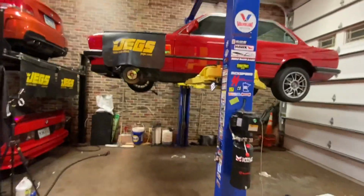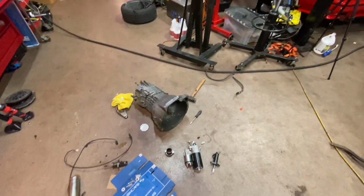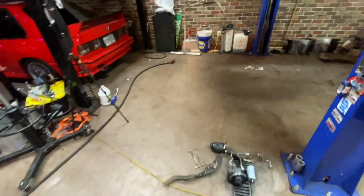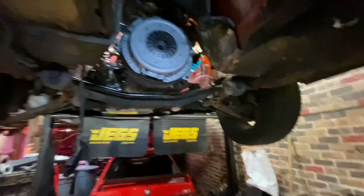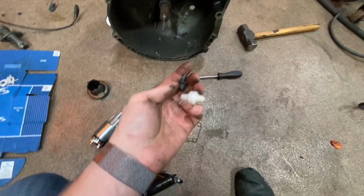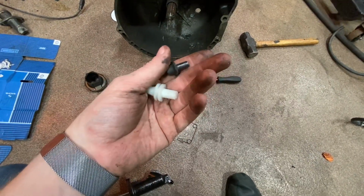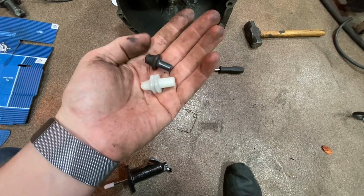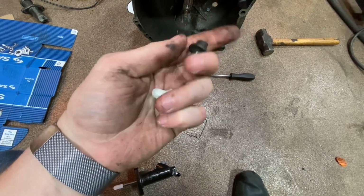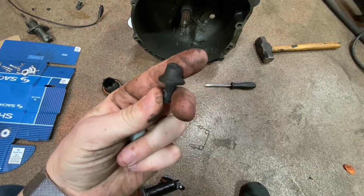Well, after what feels like an eternity, and it actually being about 2 weeks, I'm back down, and although I just got the new clutch and it's installed, which looks just beautiful, one issue I'm finding as I was replacing the pivot pin, apparently the standard issue stuff I have for the later Getrag transmissions is completely different. So back to the drawing board, I get to order a Getrag 260 pivot pin.